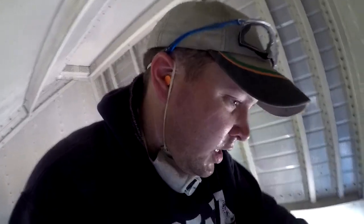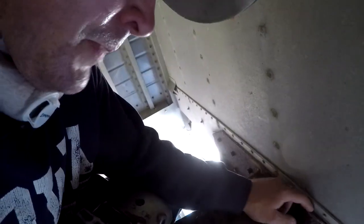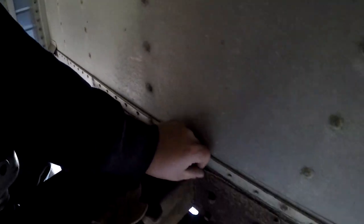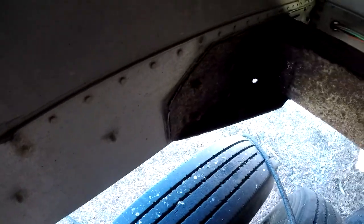I made it 10 seconds and realized I didn't have earplugs, and about 30 seconds in figured out that these goggles are going to fog up instantly. So I've been trying to go without real eye protection, which is probably stupid of me, and just pay attention to which side of the wire brush I'm working on so that it throws chunks away from me and not towards me. I'm probably going to have to crawl out and get something different though. This is some of the seam sealer that I was talking about having to peel off. I think they put it in most of the spots where there's steel next to aluminum to try to keep salt and other corrosive substances from getting in there. Not really stuck anymore. So we're going to try to paint the steel and might tape off the aluminum, because I think the paint isn't really designed to stick to aluminum. Then we'll come back and put some seam sealer back in those spots after everything is fully cured and dry.